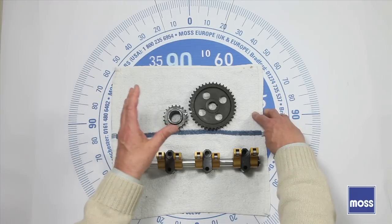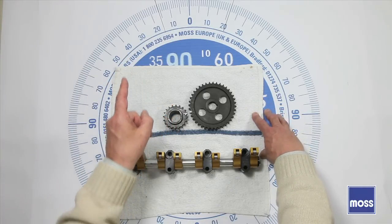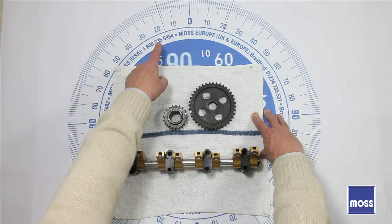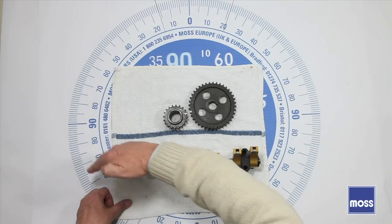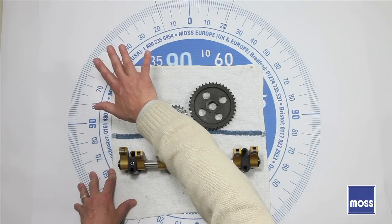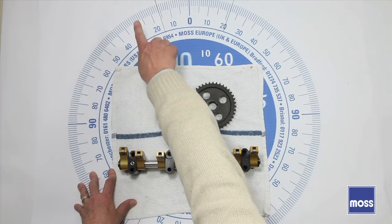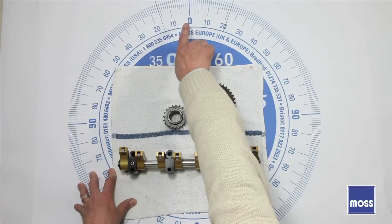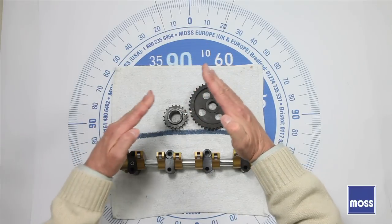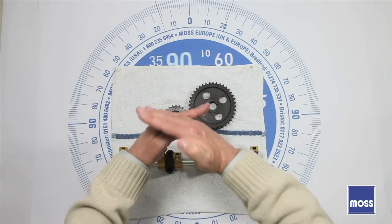The same set of specifications tells us that the intake valve opens at 16 degrees before top dead center. So imagine the exhaust is going on — the piston's coming up, pushing out that spent air-fuel mix. My exhaust valve is closing, and my intake valve is just opening, so the exhaust valve is closing and the intake valve is opening at the exact same time.